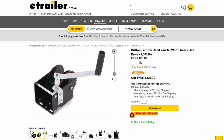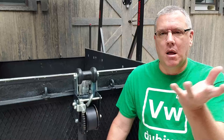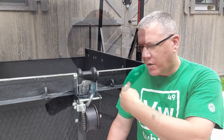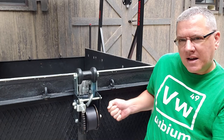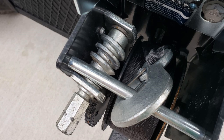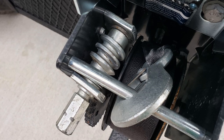I will share the details of this winch below — the brand name, because right now I can't think of it. I don't remember this kind of stuff for something so small, but it's been great and I suppose anything similar would work. The key note about this one: I'm going to call it a top mount because this winch is actually intended to be mounted flat down on the floor, but I mounted it differently so the crank turns perpendicular and doesn't interfere with the trailer. It has a worm gear in it to convert everything 90 degrees so it rotates the right way.